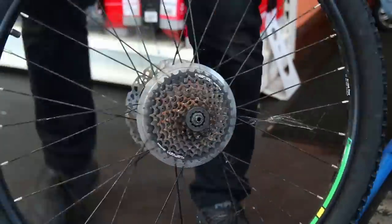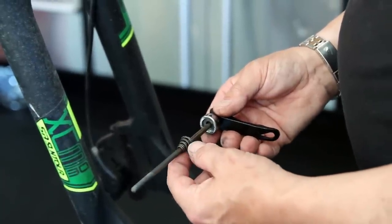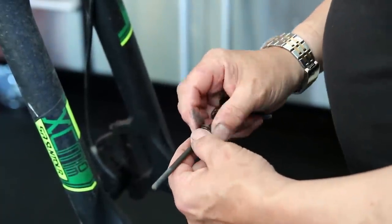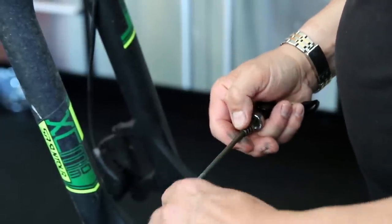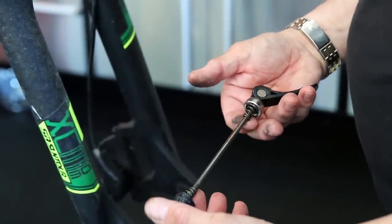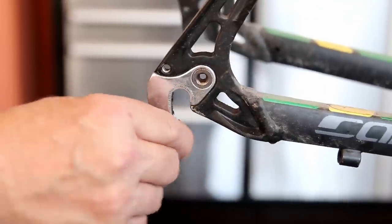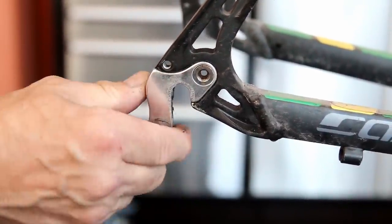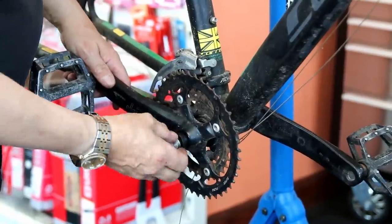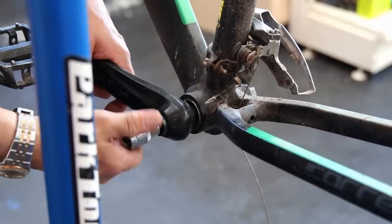We're getting components off for the ultrasonic cleaner. You can see here there should be two springs on the quick release skewer on the front wheel — there are two, but they've coiled together, which would have made the wheel hard to seat correctly in the forks. I'd guess the wheel was off-centre, rubbing on the brakes badly, and someone released all the pressure on the brake to compensate. That's my surmising as to why the front brake wasn't working.